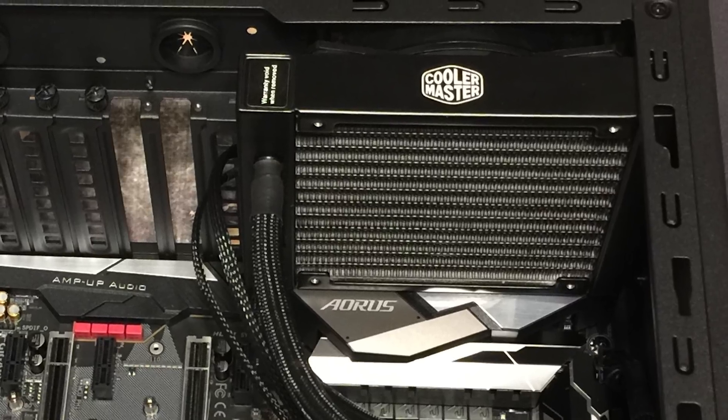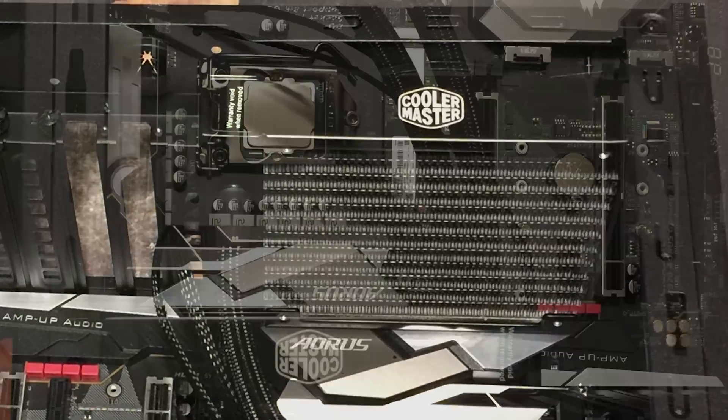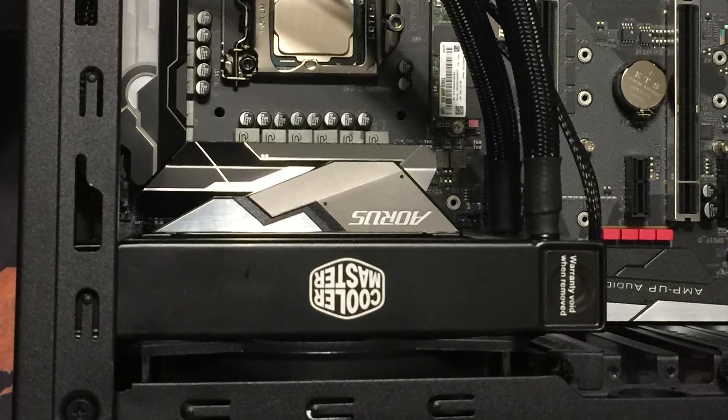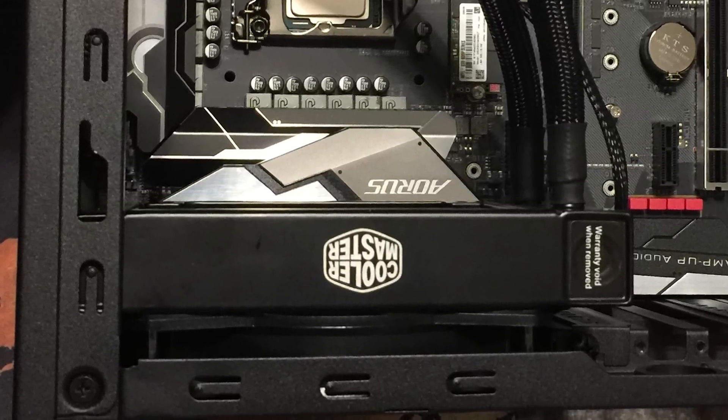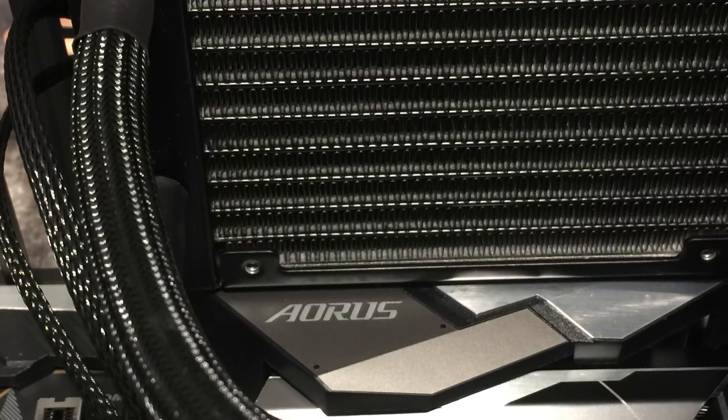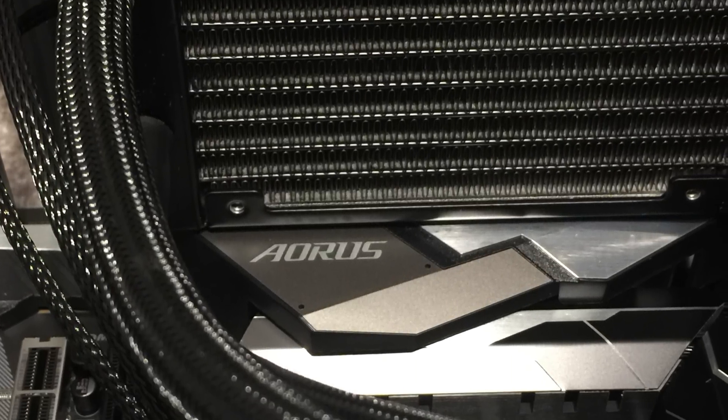The only thing to note is the fan needs to be installed in the back rather than the front — in other words, it needs to be a pull rather than a push, pushing the air out the back. The reason is because of the shape of the back of the case, the radiator itself is too large and wouldn't fit where the rear 120 millimeter mount is. The fan fits there and then the radiator fits onto it just fine. I'll show you a picture of that. It fits extremely snugly, but I did not have a problem with the plastic above the IO shield on this motherboard interfering with the fan or the radiator — they were really close, but it was not a problem.